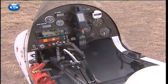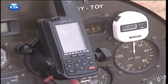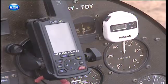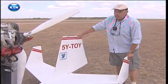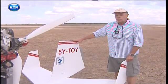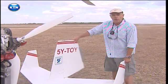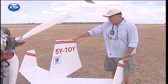Working forward, you check the controls, which are very similar to a standard aircraft. You have the rudder pedals going right through to the tail plane and rudder — exactly the same as most light aircraft — where the nose wheel for steering is connected directly to the rudder, which is also used for steering when in the air.